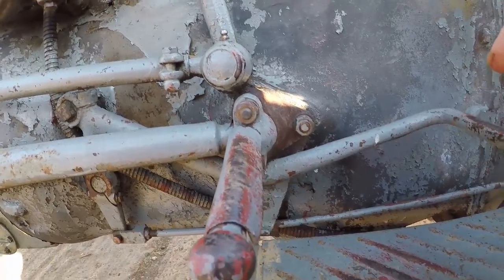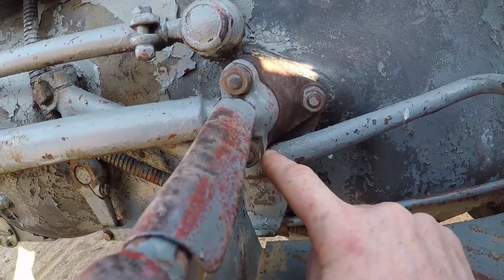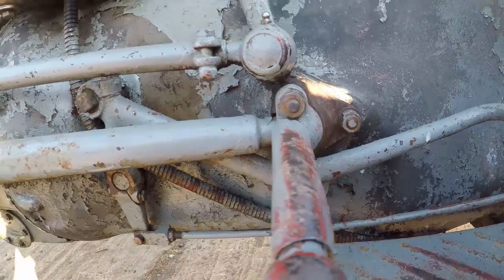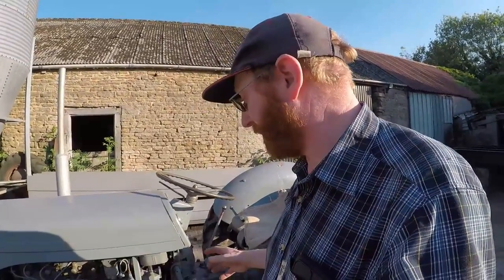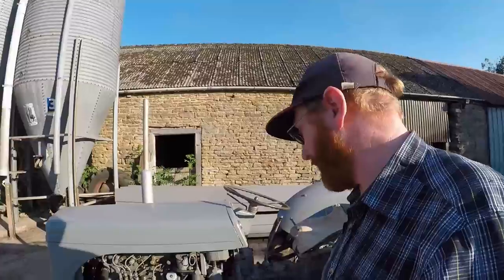What we need to do is get a gap in here of 3/8 of an inch before our clutch pedal disengages to drive, which is up in here. It sounds quite daunting to get that gap set correctly on our pedal, but it's actually really easy with just three simple tools.